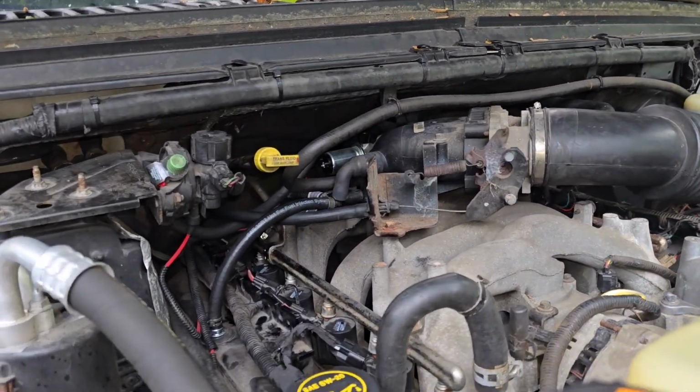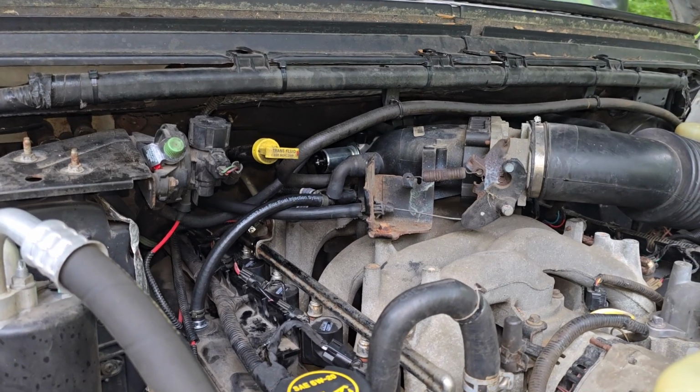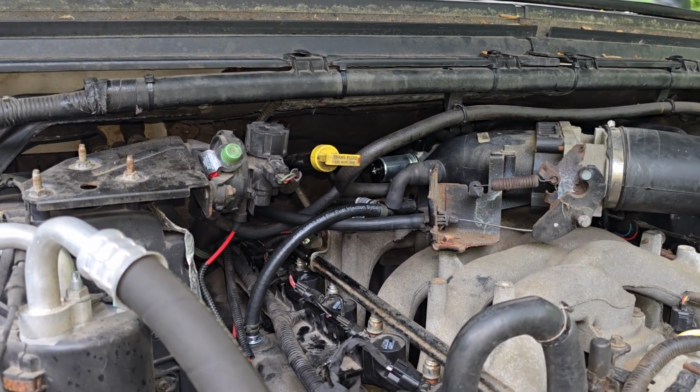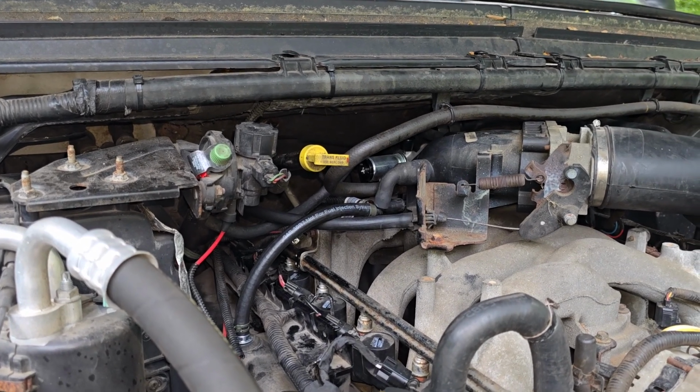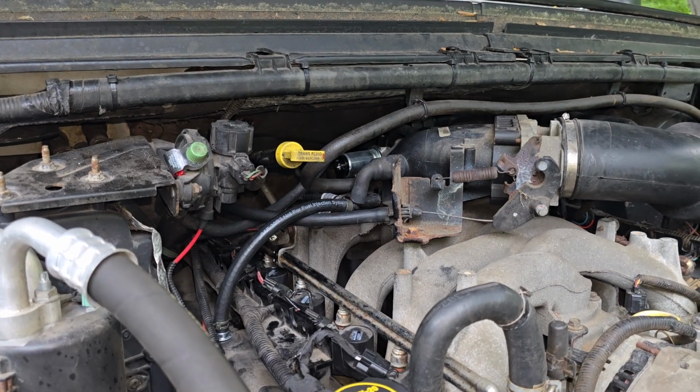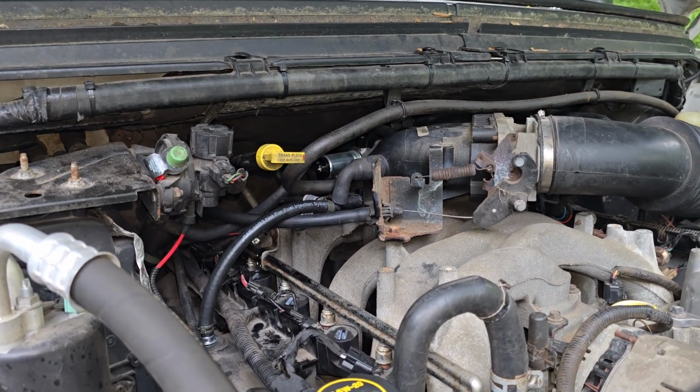Went back and smoke tested a second time. I've taken everything apart. Disconnected the fuel regulator. I've checked the fuel pressure. It seems fine. The pump is only a couple years old and it's a Motorcraft pump. Put a new fuel filter in just to do it. Everything in the fuel system looks okay.